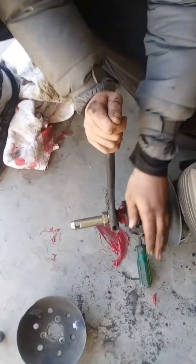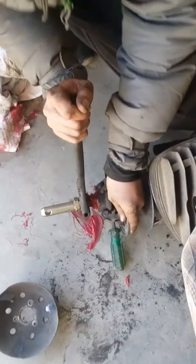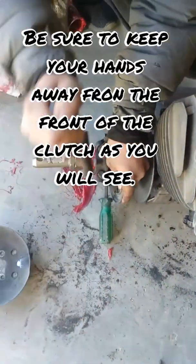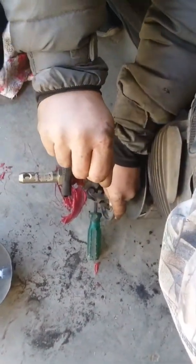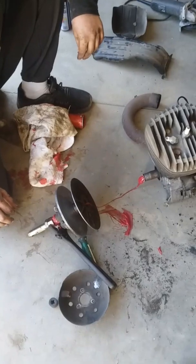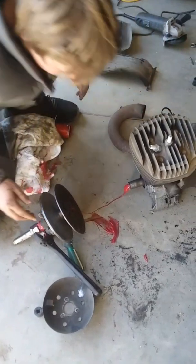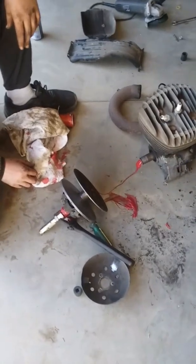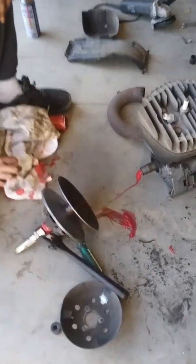Driver in the weight, and he's stepping on it to keep the motor down, so now it shouldn't turn over hopefully. Looks like it's doing good so far. There it goes — it worked! And that's how you remove a clutch with grease hydraulic pressure. Thanks to my friend Jeff from work for the tip — it worked out really good.